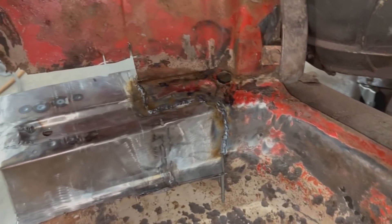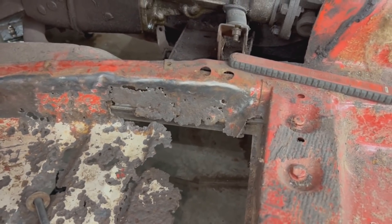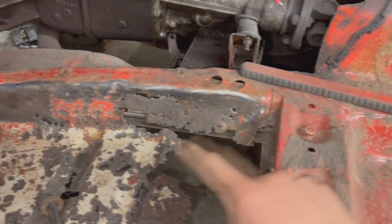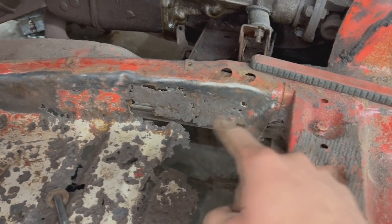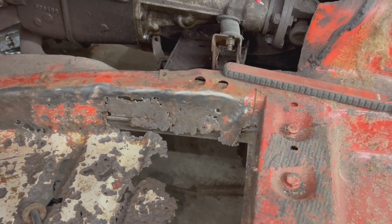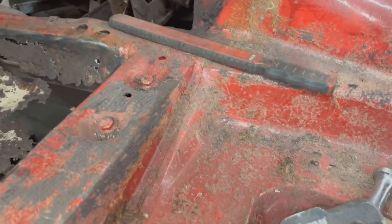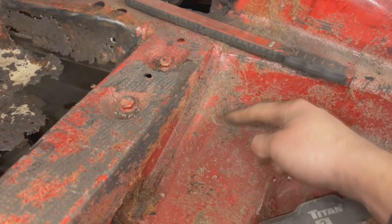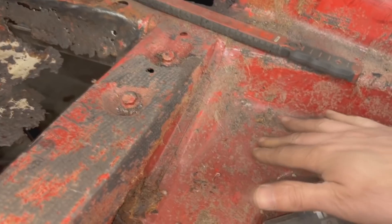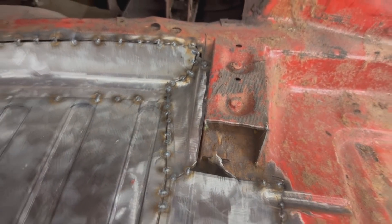Instead of working this way, I think I'm going to rebuild this part first because it's a complicated shape. I'd like to make this part first so I can match the other part to it. If I make the straightforward part first, I'm going to have to match the complicated part to that — so let's build the complicated one first. It looks complicated, but it's not — it's like a triangle which has a flange that way and a flange this way, with a little bit of bend at the end. We're going to make that — and a lot more — but we're going to leave that for the next video, because this one is already way too long.